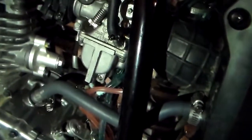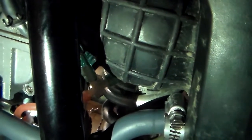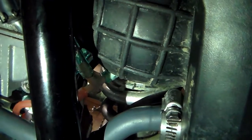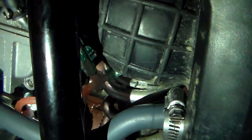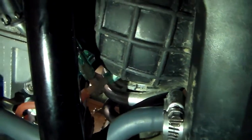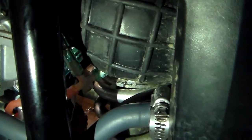But you know, if you want to go through water and these tubes do come in contact with the water, it will cause your bike to stall out until you get out of the water. So that's all the T mod is. I don't know if you can see it here. Basically, I just put a little T. You see that there? I just put a little T, I don't know what it's called, a T joint or some kind of T thing coming out of each of the ventilation tubes and turning one tube into 2.